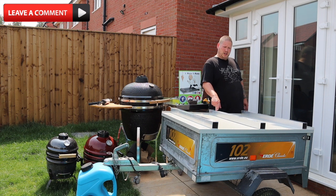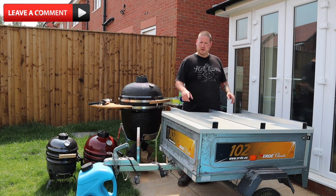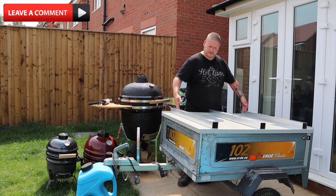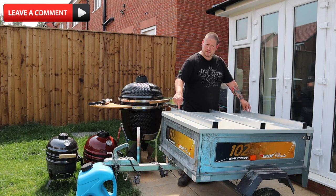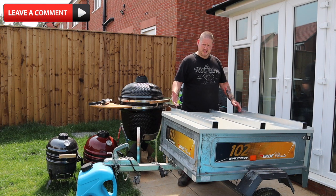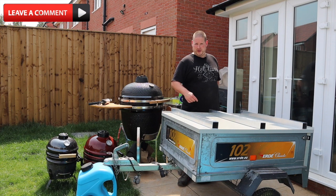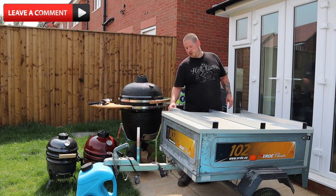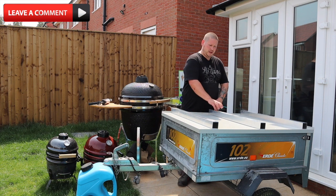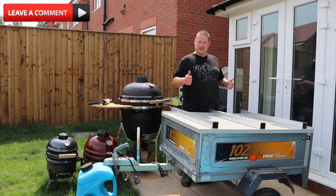I'm going to bolt the middle one down first because it's not going to move. When we go to the pizza oven, it's got legs and the legs are going to sit this side so it doesn't move. I'm then going to bolt through the legs into this box section, and this box section is then going to get bolted to the trailer — that's how the oven is going to be connected. I'm going to leave the outer ones loose because I want to bolt them to the oven first, as it will be a lot easier to drill up through the trailer through the bar and bolt it on that way. This middle one I'm going to get bolted on now, then we can hook the trailer up and go get the pizza oven on top.